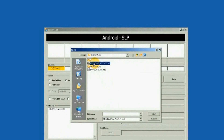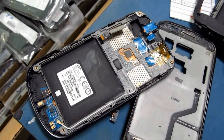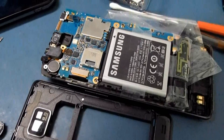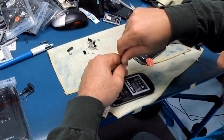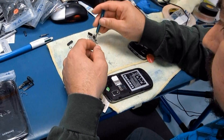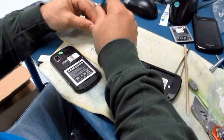But sometimes there are severe hang or frozen problems due to hardware issues. If the device has suffered water damage, been heavily dropped, or has oxidation buildup inside the phone's PCB board, this problem can only be fixed by hardware calibration and then firmware or software calibration. A mobile phone technician with good soldering skills is required for this job.